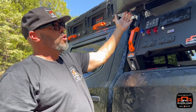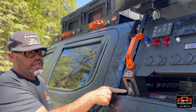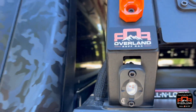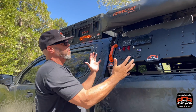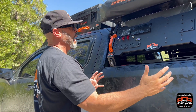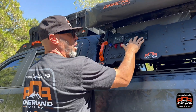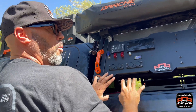The solar pulls down through the tent, goes through a mouse hole through the modular rack system, comes down and feeds right here. We have a loom here that runs to a secondary battery, so as I'm pulling power out of here I'm trickling in on the top. Now I have this complete switching center here that runs my entire back half. The brain here runs the whole Switch Pro — it's waterproof so I can run it out here, and all my connections in the back are waterproofed and heat sealed.